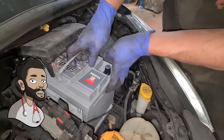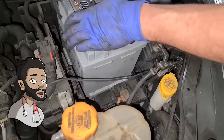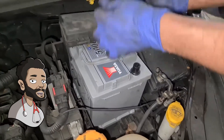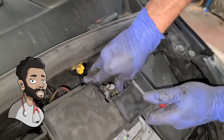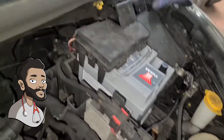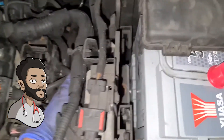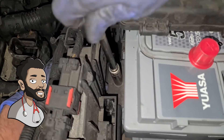Make sure you don't damage any of the wires, and then right there — so that sits in place so the battery doesn't go anywhere. I then get the red terminal out and then push it in all the way. As you can see here, I'm pushing that in now — that's lovely. And then I clip it in, that's clipped in. So all I now do is get the bracket, get my hand in there. You just look on the bracket side of it — if I push the bracket in, that's it, and then start screwing it in.